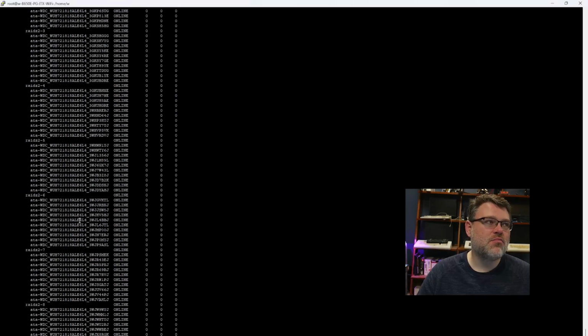And so this is one of the best performing, best balanced pools that you have, but I've already violated my own rule. I'm using all 90 disks. I didn't leave any spares. But the nice thing with this is that any 2 disks could fail, guaranteed. If you have a third disk that fails, odds are it still won't fail.